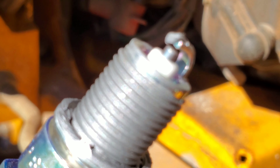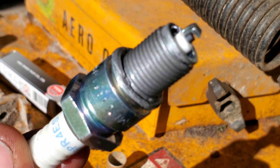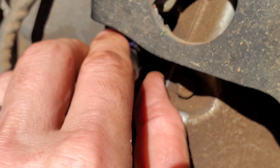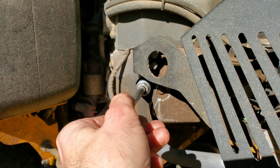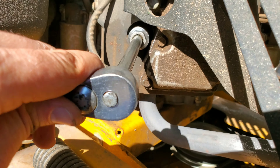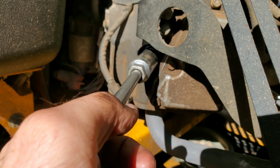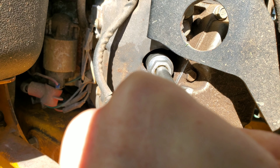Wait — I've got something on the tip of the electrode. I need to wipe that off. Okay, wiped it off — now blow on it. You don't want any kind of debris or dust in your engine cylinders. That's a good thing about doing it yourself — you know that's not going to happen. Put it back in, threading by hand. You don't want it too loose, but you don't want it too tight either — you'll strip the threads out and destroy the engine block if it's too tight. You've got to get a feel for this.